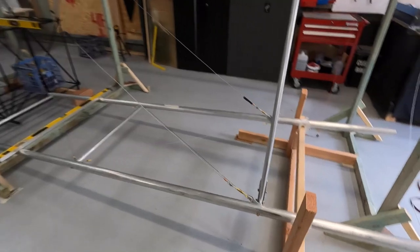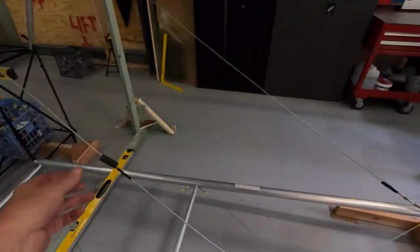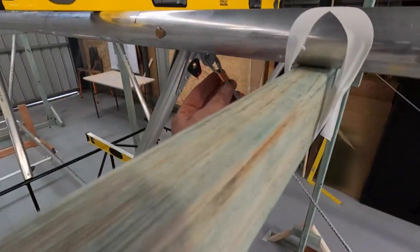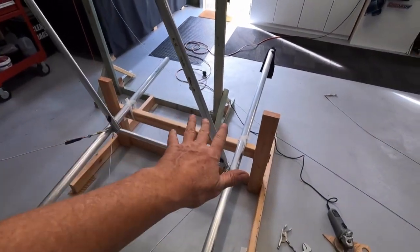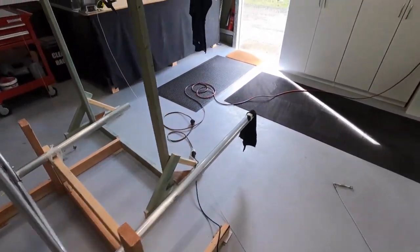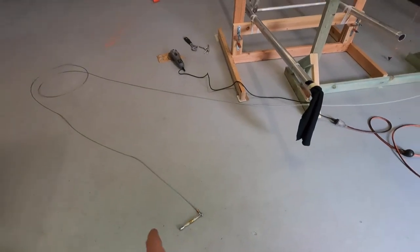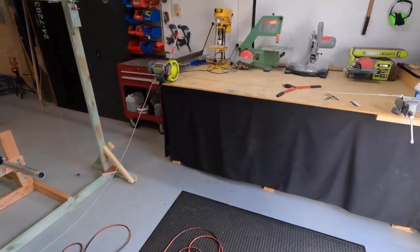So I've got two flying wires on, just in position. I just have to manipulate the tangs so they point the right direction — very loose. I haven't crimped this end yet, so I'll pull that through. I want to undo the tape just to make sure I'm not lifting the wing as I do that. The turnbuckles are set up and another one over here. I just do both ends of the cable. I've got about 30 feet of cable here — do both ends then cut it to length.